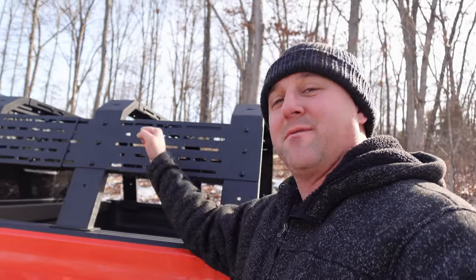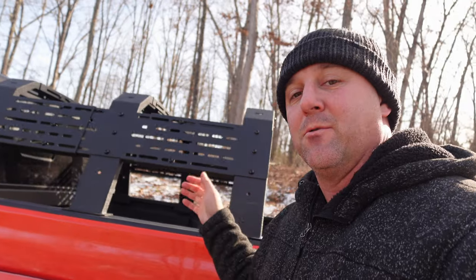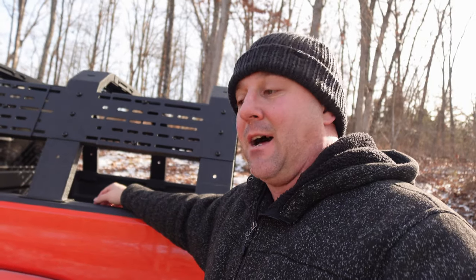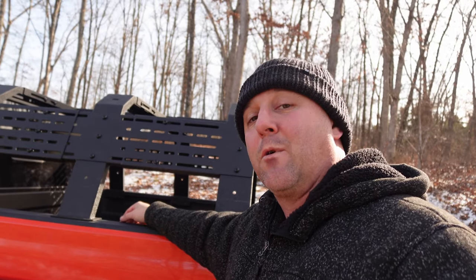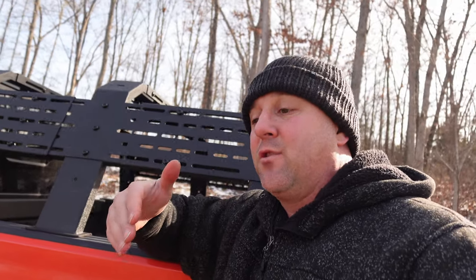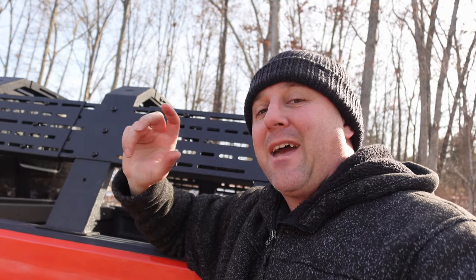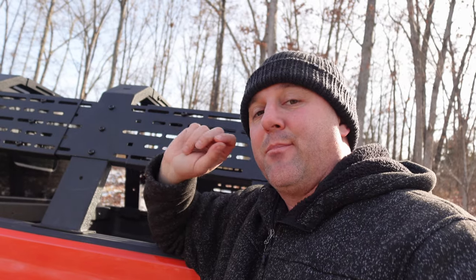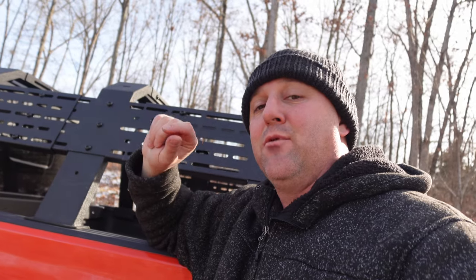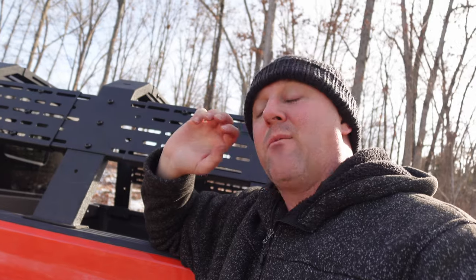I found the root cause of that rattling sound. I had a bolt I missed — it was loose and must have rattled out, because I found the nut in the bed but the bolt is gone. I'm going to go back over this one more time and check all the bolts. My recommendation: if you're going to build this, buy yourself a little tube of blue thread locker — that will make sure your bolts don't rattle off. I think I just missed this bolt, but the blue thread locker will absolutely guarantee they won't come loose completely.